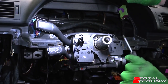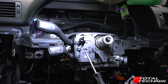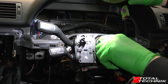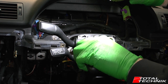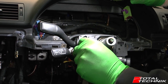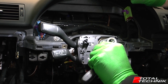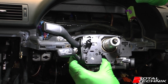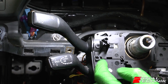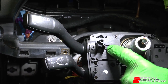So once this stalk is out of the way, we've got the remaining stalk and your cruise control. These need to come out as one — unfortunately this lower unit doesn't come out on its own, and I'll show you why. You've got these black screws in the cruise control unit itself, the same as the other screws on the other side that you would have just undone. But you'll see you can't actually lift it out with this stalk in place, because it's curved on the side, it sits around it, and it's got a little plug on the back that won't allow it to come out. So we've got to take this unit out as well.